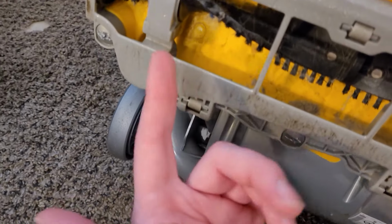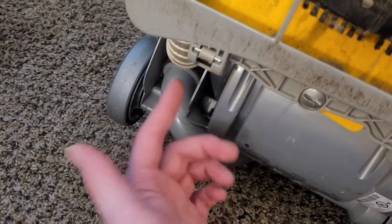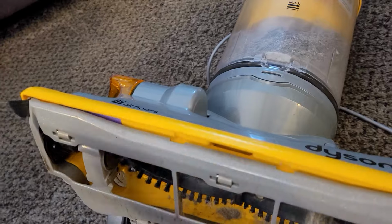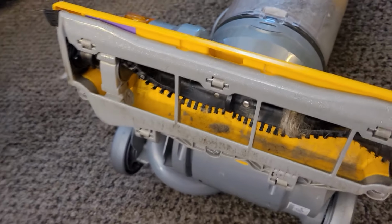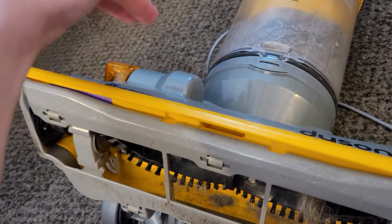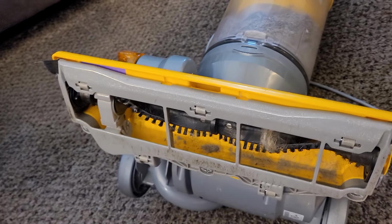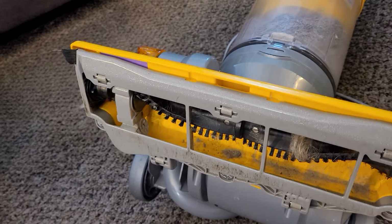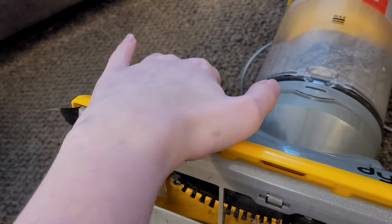And then we also have, like I mentioned, that secondary belt that frequently fails. And by now, a lot of these clutch assemblies themselves are probably worn out to the point where the entire assembly needs replaced, not just the belts. And the clutch assemblies, unfortunately, are now, as of now, just recently discontinued and no longer available, although there are some places that still have remaining stock being cleared out. So try to rebuild these clutches if you can.